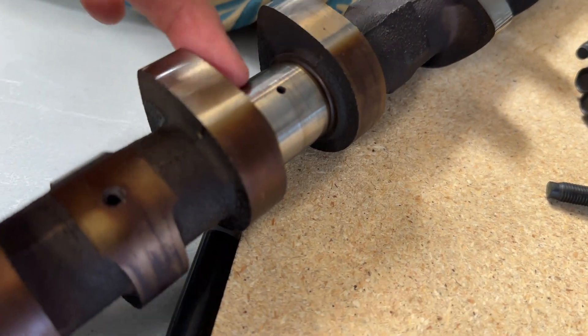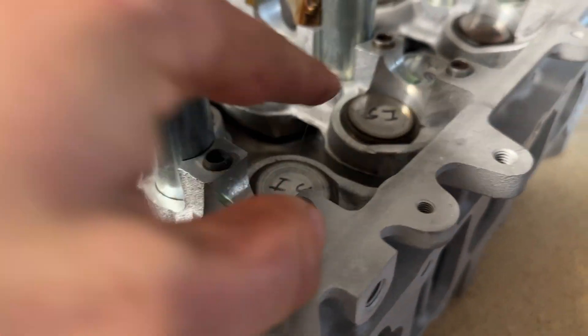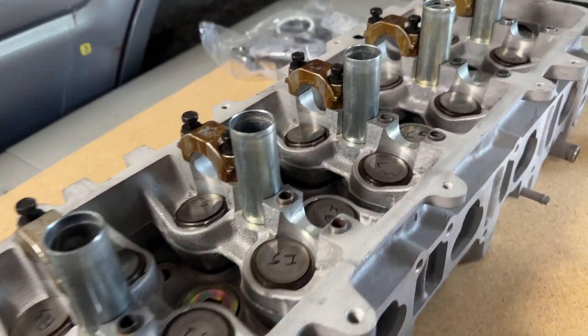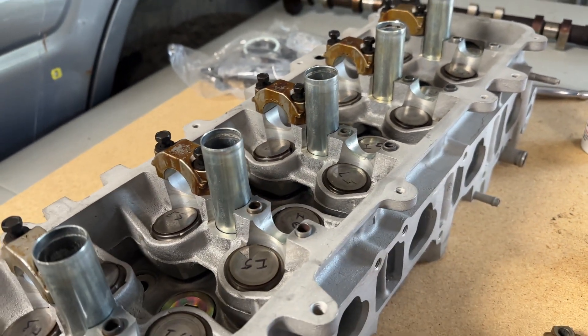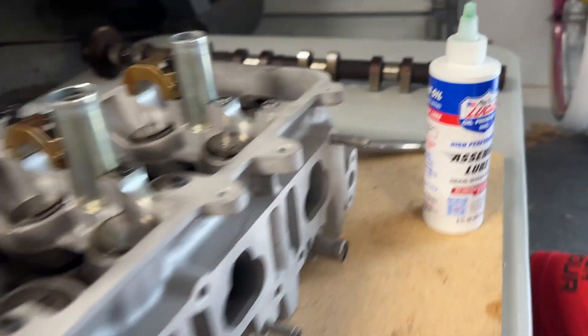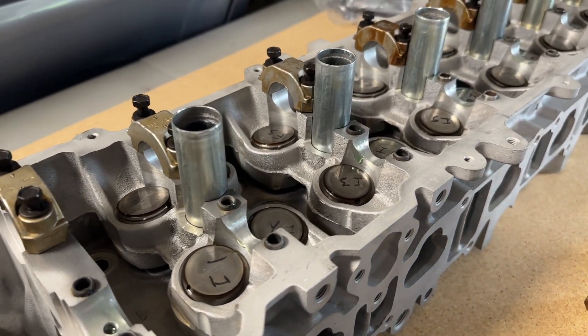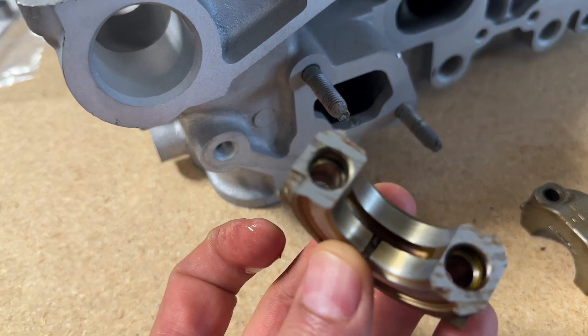You've got to remember these cams — that's the section that rides on the little bearing inset on your cylinder head, so it's metal on metal. You want to make sure you've got everything greased up good. Assembly lube is really good — it is really nice and sticky, so it's not like oil where it's going to run off. I really like the Lucas assembly lube. I'll put a link in the description; your local auto parts store should have it, or you can get it on Amazon. You also want to put assembly lube on the surfaces on your cam and on the surfaces of your cam caps.